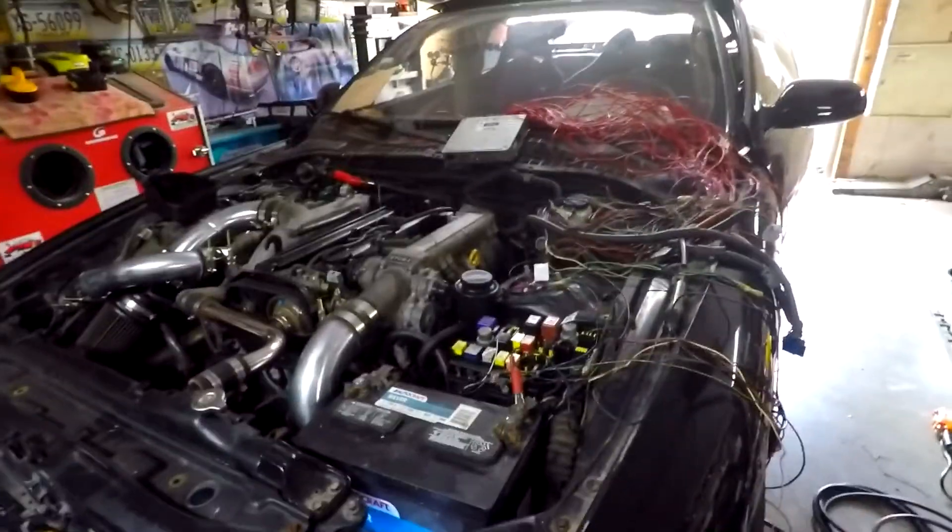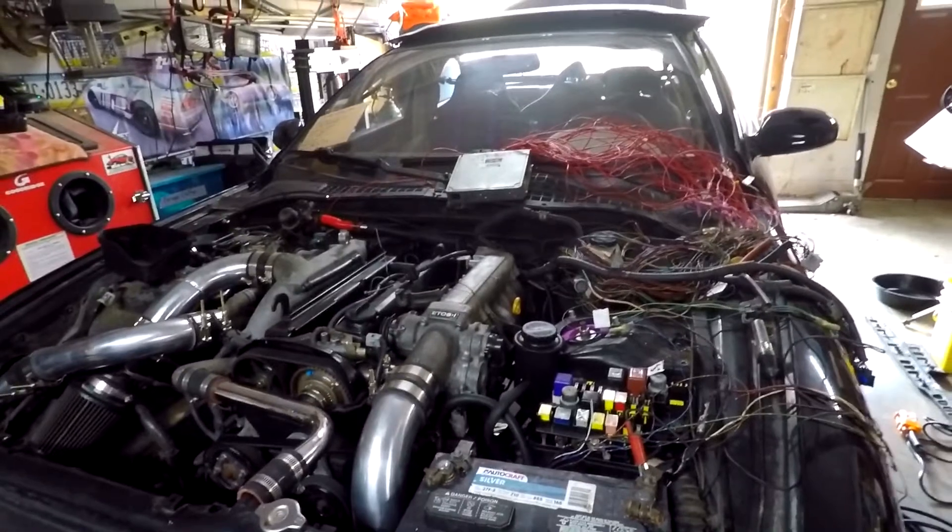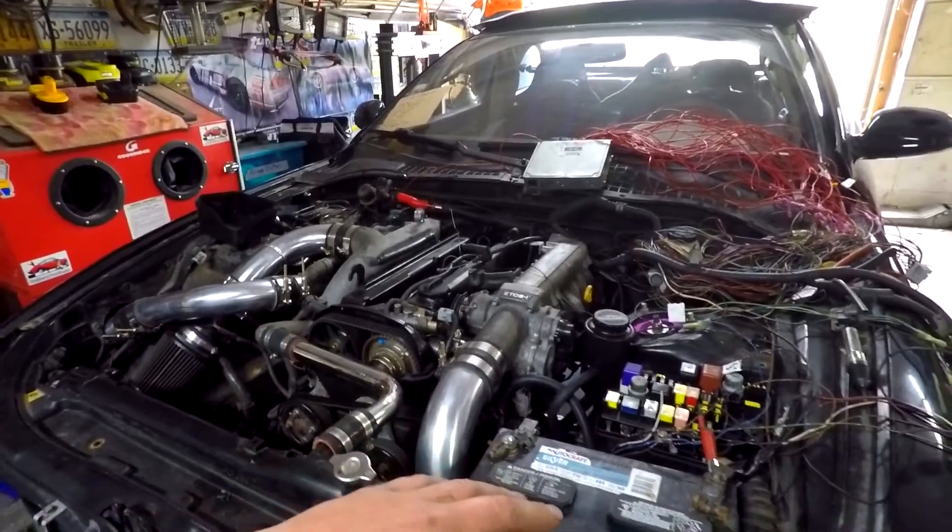I don't even know what day it is anymore. This is all going on in one video because there's not a whole lot happening, but we ended last night with starter failure. Unfortunately the oh-so-pretty 1J starter is out — the solenoid was garbage. Must have got a good bit of water in there because it was rusted up at the plunger and the plunger was not working. So we swapped that out, put the 2J starter in, and although it's quite different, everything we looked up says they're interchangeable. Put that in, wired it up, changed the plug on it to the old style off this motor, and it was not doing anything. The solenoid was engaging, but it would just hit and then turn the motor over just to barely and that was it.